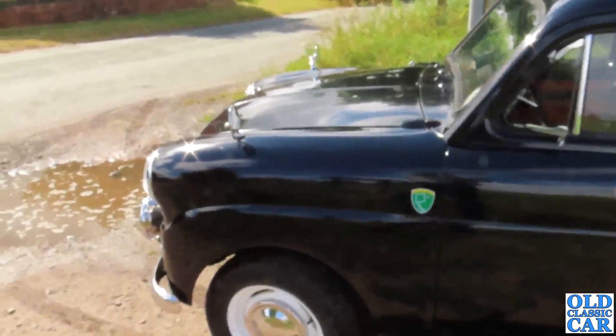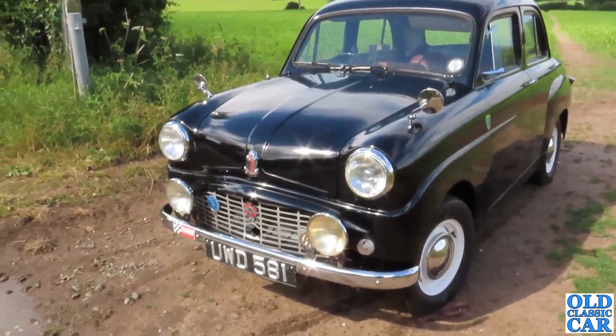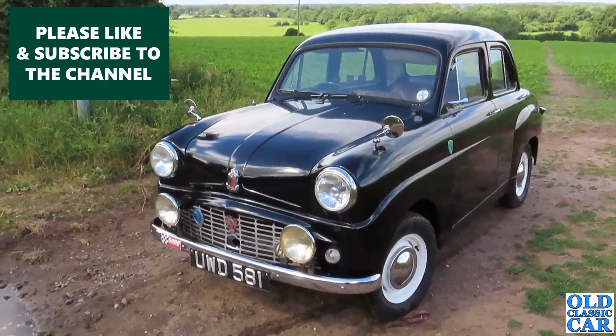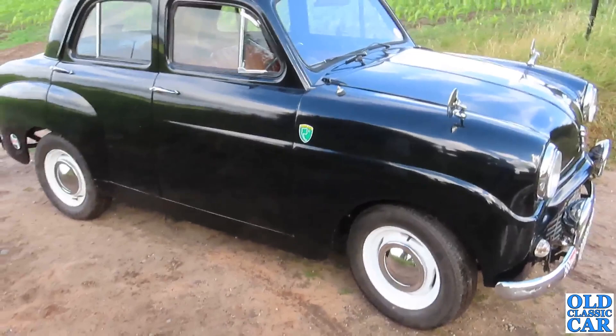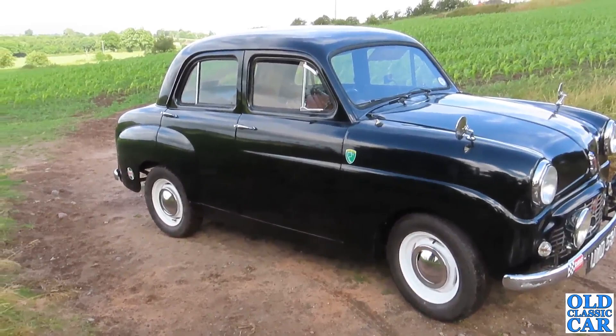That's a few more miles done. I put a spot of fuel in just to keep things topped up - don't want to run it too low. So what have I learnt on today's first run out in the Standard Eight? Starting from the back: the diff seems good, not particularly noisy, no worrying clunks or whines or groans. Same for the gearbox - that seems pretty good. The gear selection is a little bit vague but that's probably just down to technique. Clutch works fine, biting point seems good. Engine is good essentially, just a little bit noisy at the top, so I think the tappets need revisiting. It may be there's a bit of wear in the rocker shaft that's not adjustable out, so I need to keep an eye on that.